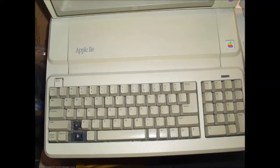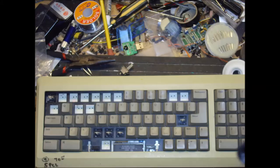One of the things you'll commonly encounter with the Apple IIEs is missing keys when you get these used. One of the things you can do is take keys from a sacrificial keyboard, one of which could even come from a Macintosh, the model M0110, or the extended one. The keys fit the same and the mechanisms are pretty similar.